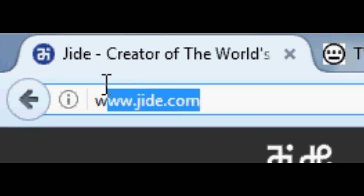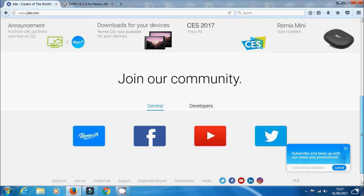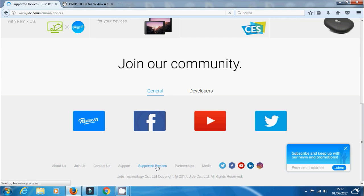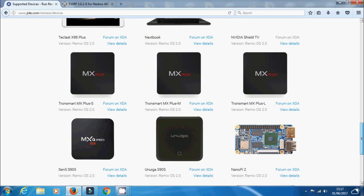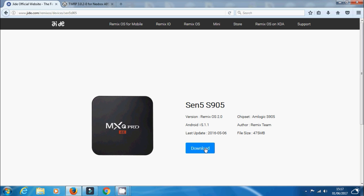So let's head to Jide.com. I'll leave the links in the description. And then just go a little bit further down the page and click Supported Devices. Now again, go down to the bottom of the page and you'll see MXQPRO, you'll also see MX, etc. They're all for the S905 processor. Click on the appropriate one. I want to use the MXQPRO and download that firmware.